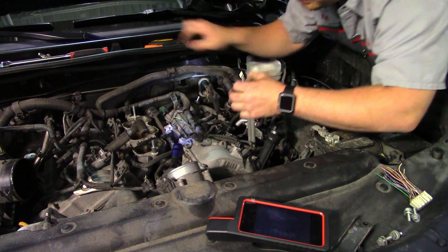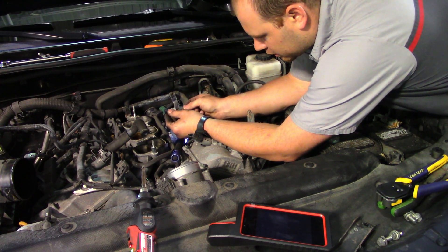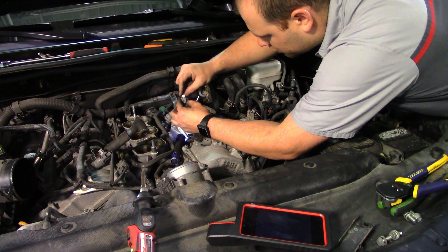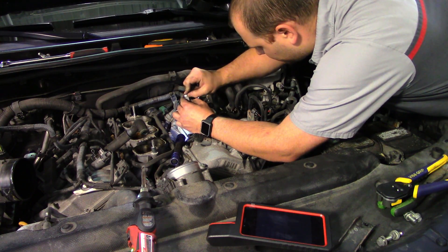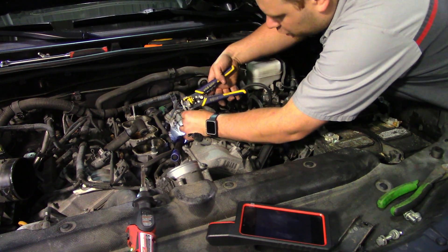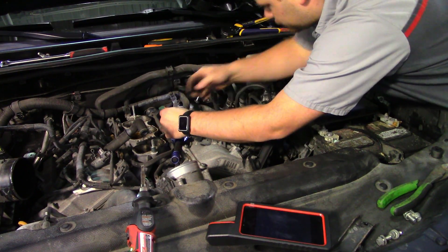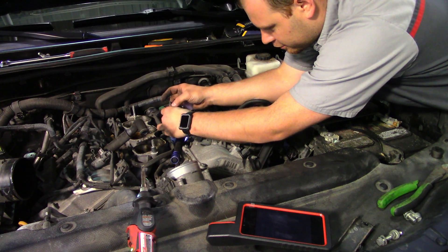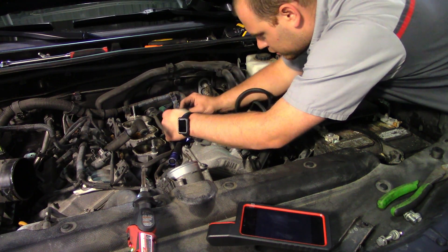Get your terminal. I found a green terminal — slide that right in. There's a lock. Lock back in. I'm going to solder this new terminal in. Make sure you put your heat shrink on. If you forget your heat shrink, you're screwed — ask me how I know. I think we've all done that one at least once.